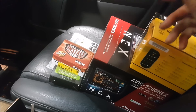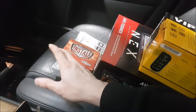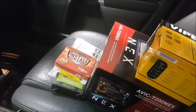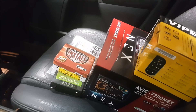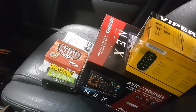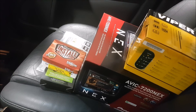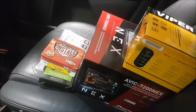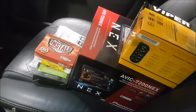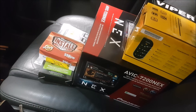Sometimes when you're using these two brains on an older vehicle, you might get data collision and the units get confused. Like on my truck — when I would remote start it, it would run for five minutes then just shut off, reset the tach a bunch of times in cold weather. It wouldn't work nine times out of ten. I was getting data collision. So I just turned off engine sensing on the CompuStar and cranked it for two seconds because it's anti-grind. You can't do that on every vehicle — usually only newer vehicles past the 2000s. For certain vehicles you have to fine-tune the install to your situation.